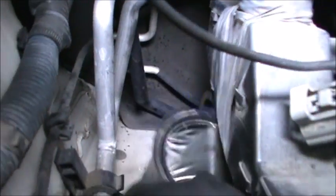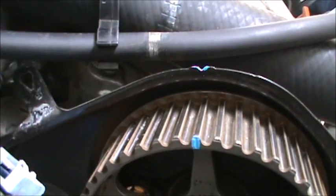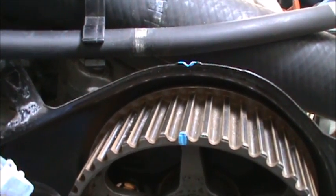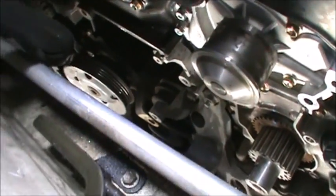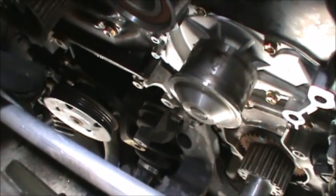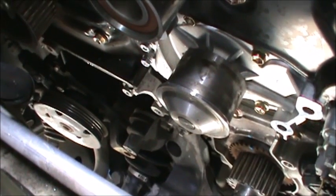All right. So this one over here, though, this is just right here. So they didn't really move around on us. We'll put the belt. We'll start at the bottom. Actually, first, before we put the tensioner, we're not going to put the tensioner yet. We're going to put the idler. We're going to tighten that down. I'm going to put a little bit of Loctite on that too.